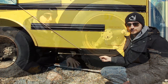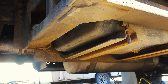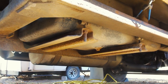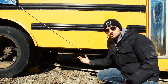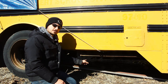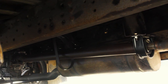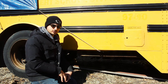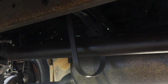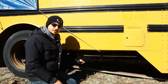For the fuel tank — on this bus it's on the side, but some are located behind the rear tires in the middle. Look for any fuel leaking from the tank itself, and check the condition of the tank, the rails, and brackets holding it up for excessive rust or sagging. Walking down the middle of the bus underneath, you'll see the drive shaft running from your transmission to the rear differential. There are protective hoops along it that prevent the drive shaft from hitting the ground if a bearing fails.